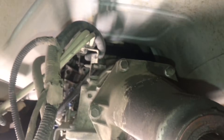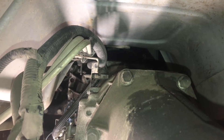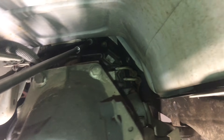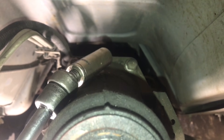The reason you want a long extension with a universal socket is that if you stand behind the truck at the tail shaft of the transmission, you'll have a clear shot to all the bolts — especially the ones on top. You can slide it straight in and reach the top center bolt and all the surrounding ones. It makes the job a lot easier.